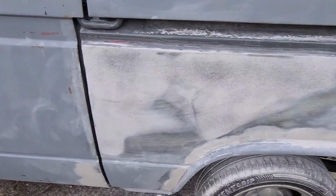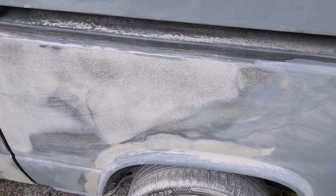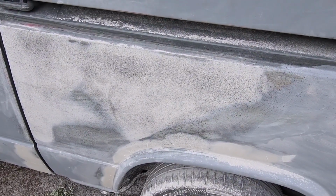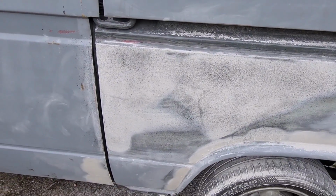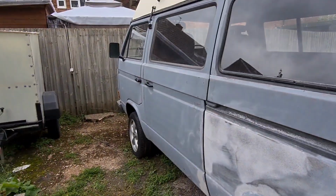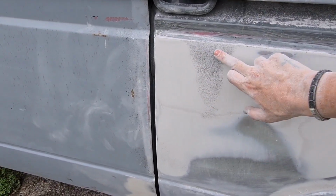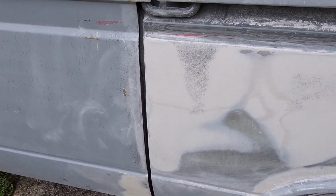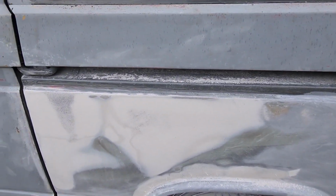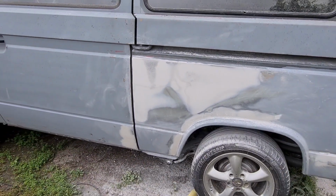We can also use guide coat on the filler as well, similar to the primer that I showed you in, I think it was, last week's video. So obviously you knock that off and it will show you where all the low spots are, and the high spots. I'll quickly show you what I mean. Started to rain, so I'll quickly show you. See there, blocked it, just left that V. Obviously that's lower than the rest. A couple of high spots there. That's what we use the guide coat for as well. It also helps with the filler. I'm going to carry on with that.